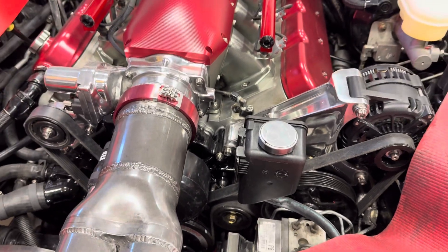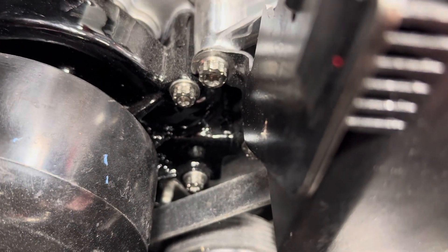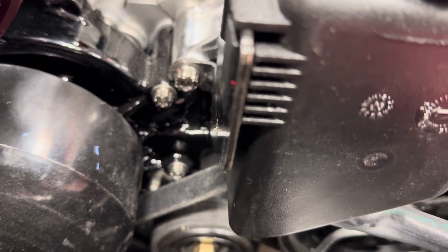Hopefully I can illustrate this real quick — forgive my sinuses, they're toast. You see this one bolt above the other on the water pump; you'll loosen each of those. And then you can see the balancer down here below.